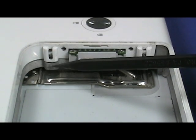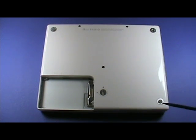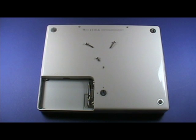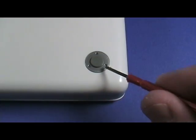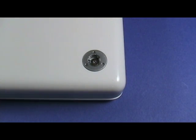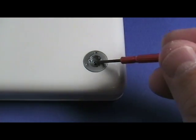These are the two springs with caps at the battery connector. Next, remove the three feet and the three screws securing the bottom case. The two long screws shown here were removed from the edge near the back, and the short screw from near the center. The feet can be removed by first using a small flat head screwdriver to pry them up. Once each foot is removed, remove the screw underneath it, then lift the remaining piece out as shown.